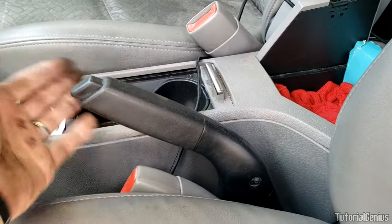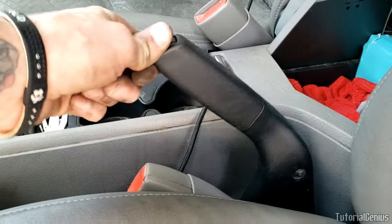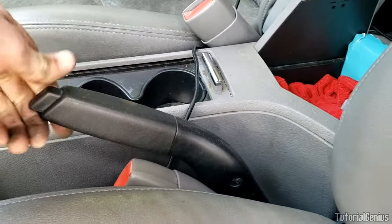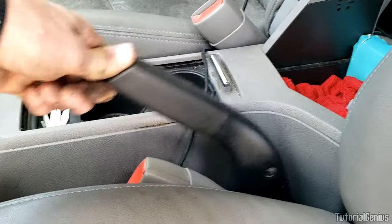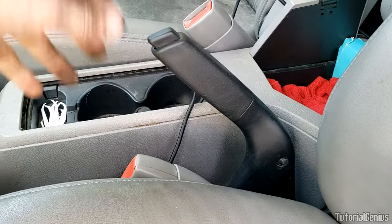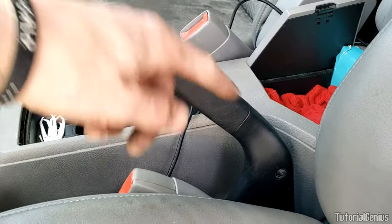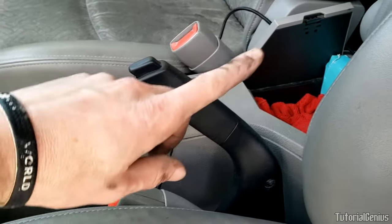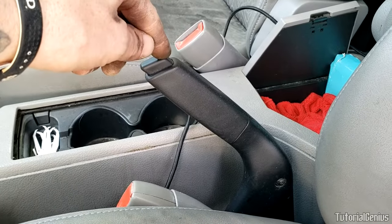In this video we're going to be adjusting a parking brake, or handbrake, or e-brake — whatever you want to call it. It's this little device you use your hand to stop the car. You can see this one has lots of play; I'm barely using any force and the car can still drive with it set. So something needs adjusting — whether that's a nut where we adjust the cable or something more serious in the rear end of the car.